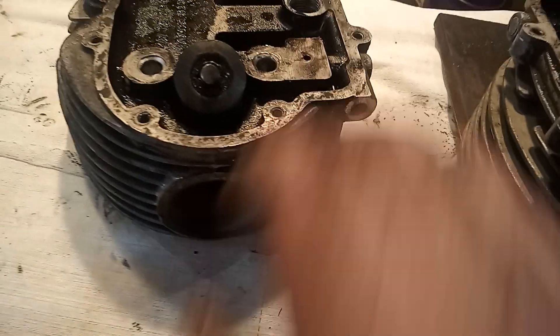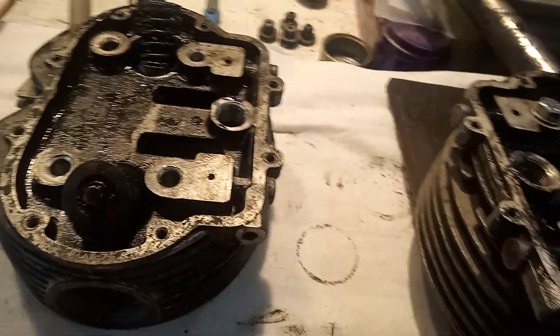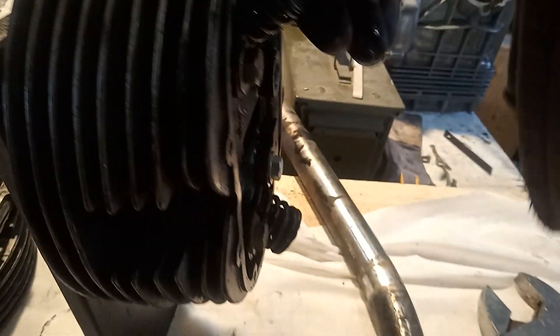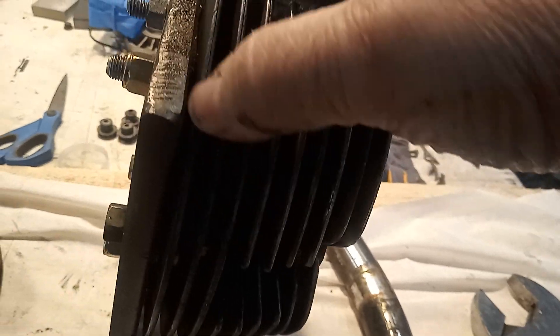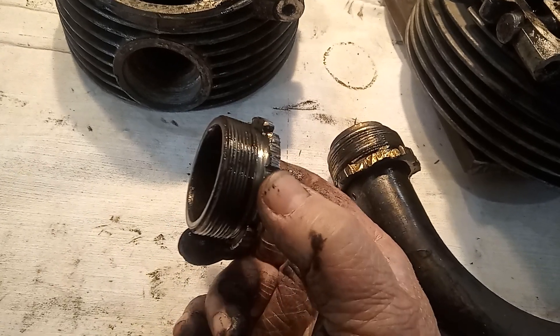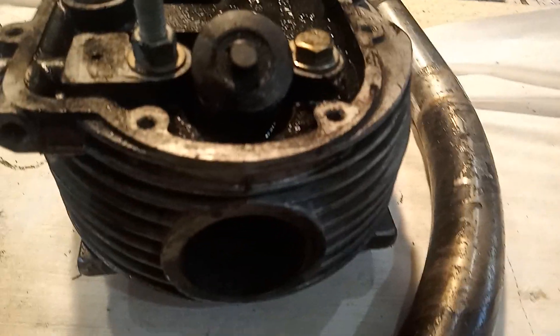In the meantime, this wasn't on the bike — I'd taken the heads off. What I did was I made a plate to take up where the head bolts would normally go, with an old gasket in between to protect the gasket surface of the head. Anyway, once that one was done, I set to work on the second one. Because I knew what to do, it came off relatively easily — just a couple of overnight soaks, application of heat, and out she came. This one admittedly was not quite so badly corroded, but corroded nonetheless, and there would have been a ring of corrosion stopping me from undoing it easily. So that's how you do it.